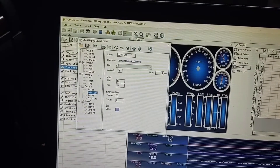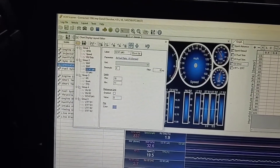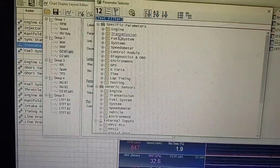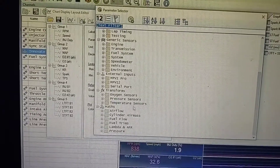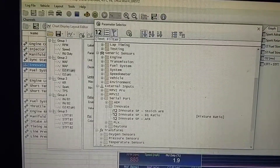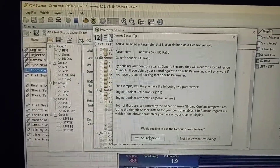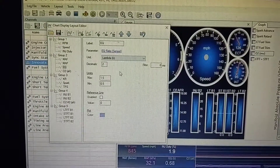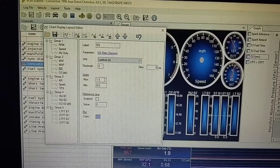Just go default diagnostic O2 AFR, and then it'll show up down here. Then I move this up. Where it says Parameter — Air Fuel Ratio 1 — I left that where it was. Then I went in here where it says Serial Port, and went to Innovate because that's what I have. I click this — you can go in and put custom stuff. But I had a problem with the max value, probably because of lambda. That's why it's 1.5. So it would work like this, but I'm not comfortable with lambda yet.